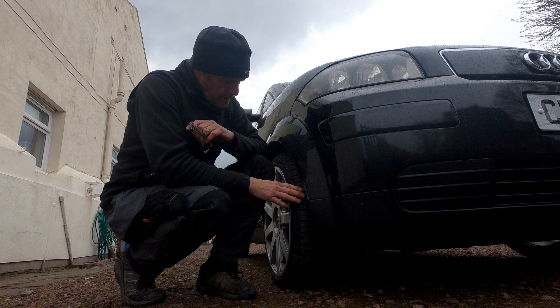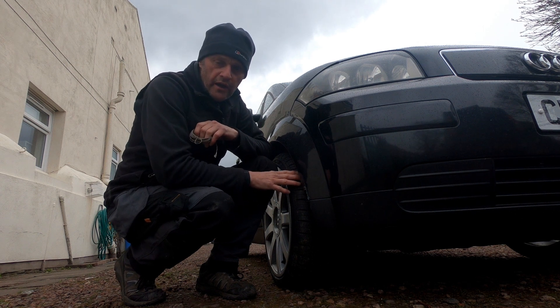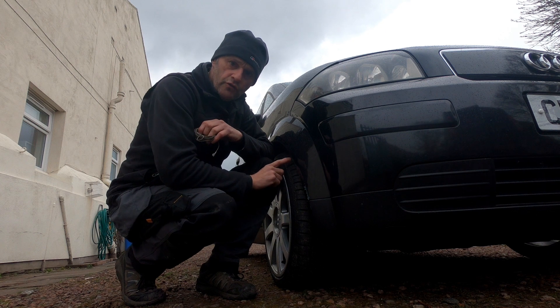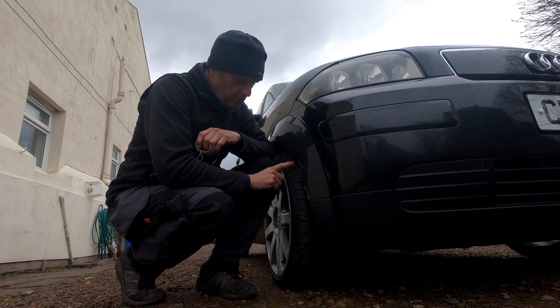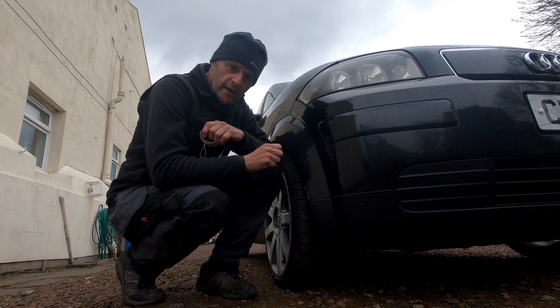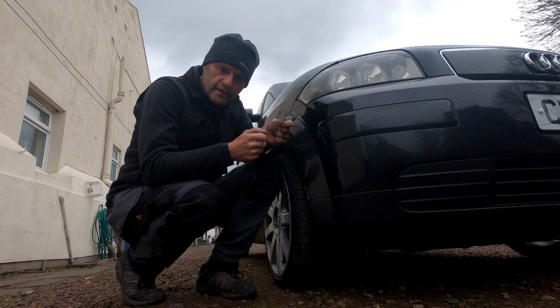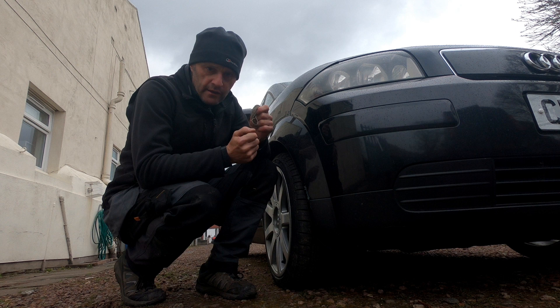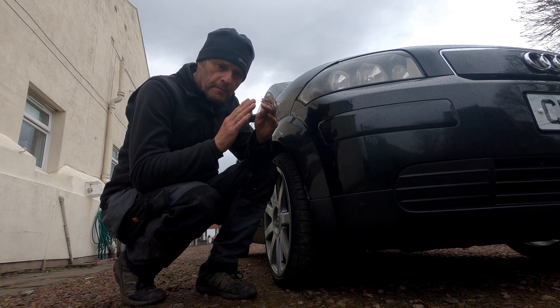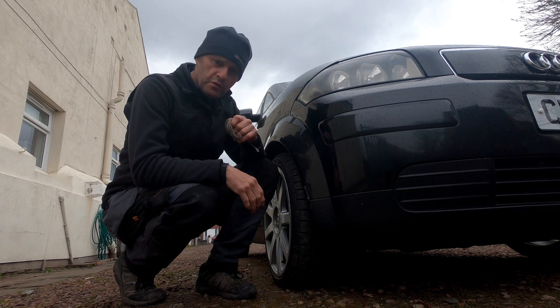Since I've put the new tyres on the RS4 rims and having done the track rod ends, the bottom ball joints and the wheel bearing, the steering wheel is slightly off-centre and it feels as though it's very light and tracking going down the road, and it slightly pulls to the right.